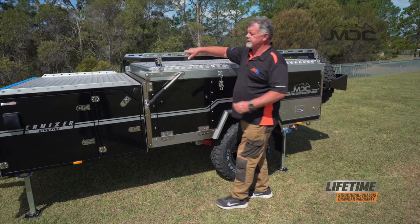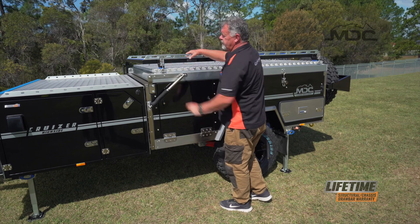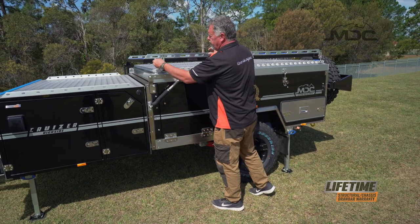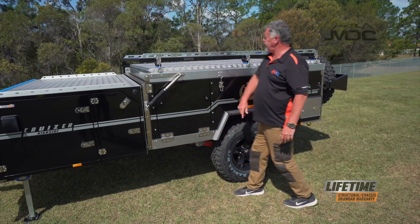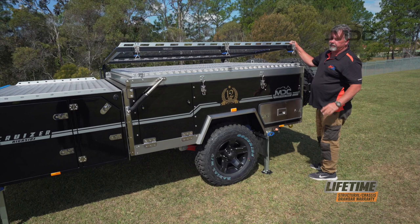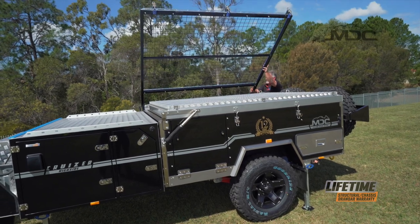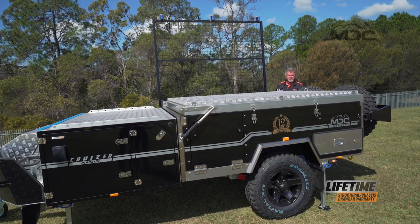Now before we open up the lid of the camper, we need to open the boat rack. Each clip will come with a little linchpin. You need to remove those and unlock the over-centre latch. As I do it, I raise it back up. I can even put these pins back in here for safe keeping so we don't lose them. That also keeps this little triangle from re-trying to hook up underneath there. Now I can raise the boat rack — it's easier with two people. You can have someone on the other side to steady as it goes back, or you can just walk it along. That'll lock in position out of the way and we can start unlatching around the camper.